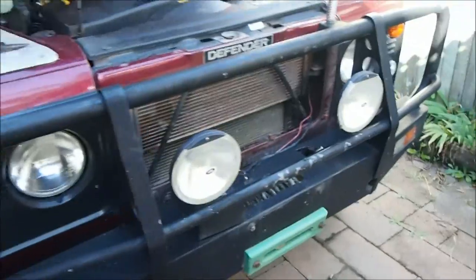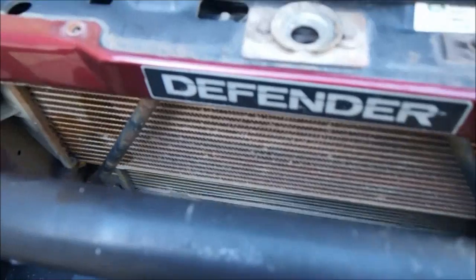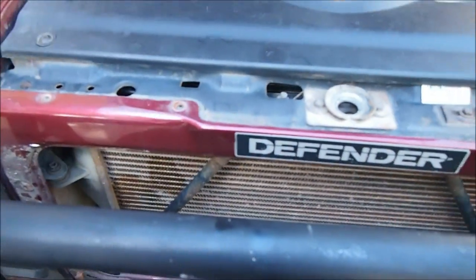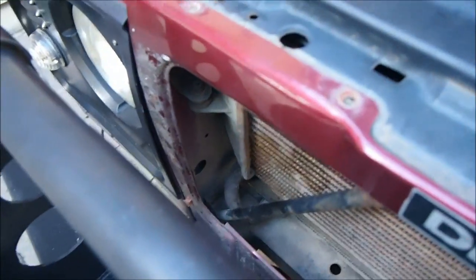So what I've done first is take off the front grille to get more access, and what I wanted to do is take off this whole piece. Down in there, this bolt comes undone, but on the other side, the same one's been slipping, so I might not be able to pull it off with great ease. I might leave it on, just so I can pivot and get better access down to this back bit where the winch has to come out.